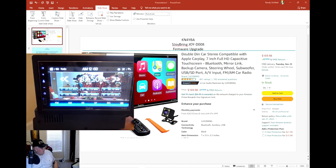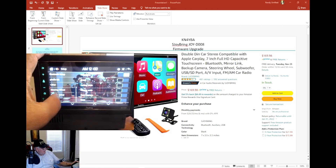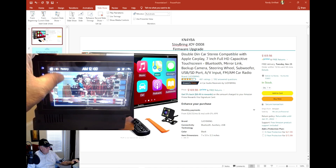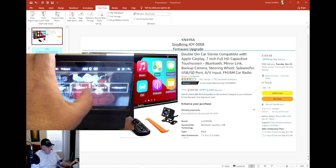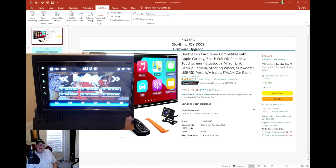There are different wallpapers you can set up. Go to home, then setup, scroll down to factory setup and enter the code: 6, 6, 9, 9, 9. From there you can look at the logos and different changes you can make. For example, under wallpaper you can browse wallpaper two, wallpaper three, wallpaper four. I think my daughter liked that one, so I'll save it like that. Hit back to home, then back to radio. That has set up the logo and wallpapers.